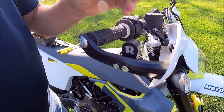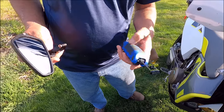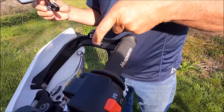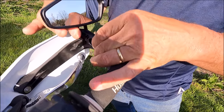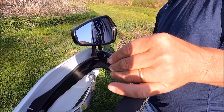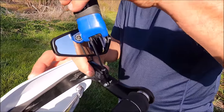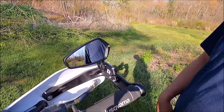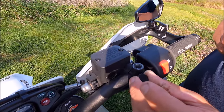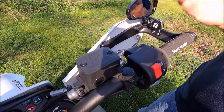Get it close. This is the rubber shim I was talking about. I'm going to go ahead and loosen this up and put this on — this is a three millimeter Allen key wrench. It just fits into there to loosen it up, and all you're going to do is slip it right over this, like so. Piece of cake, and then I'm going to try to get the same angle which I already know works well. Tighten it up. There you go guys — quality of glass is superior. Also, these are where the old mirrors were, and they give you these little black caps, which I think is a nice touch, and they simply pop in like that.